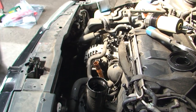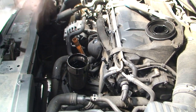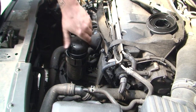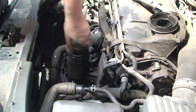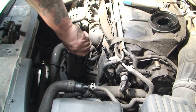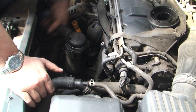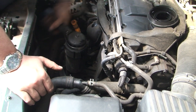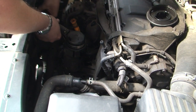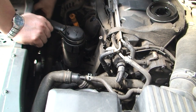So now that's done — just put it back. Make sure you actually get this in the locator hole; if you don't it goes too high, so you can't really go wrong, but just make sure you get it down. Always hand-tighten this first, because if there's any problems it will stop. Don't put a machine on it straight away — just get it as tight as you can by hand, then you can go with the tool. It's only 25 newton-metres, which is not a lot of pressure — just give it a nice nip.